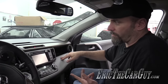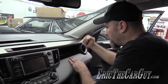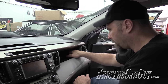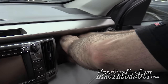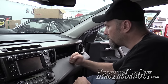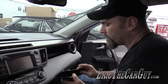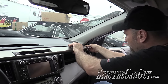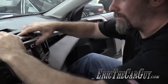There was another one down here in the dash. It seems like something in this area. I noticed this little panel under here — there's a little rubber piece for that tray. When I remove this panel the noise is pretty much gone. I think this rubber piece is supposed to dampen whatever noises are there, but it just doesn't seem to be doing the best job. So we're going to make this less noisy and also address this other one, which is even more annoying — I'm going to get behind this trim piece and shore it up.